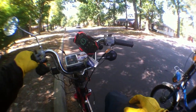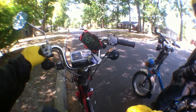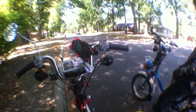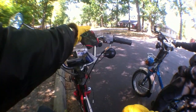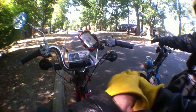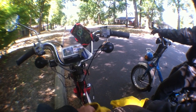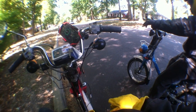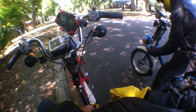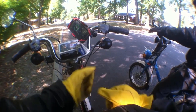Here's Carl and I having a little powwow at the pass. His bike was running kind of hot today and we kind of corrected that. We might have to do some more, but his does right around 40, 41, 42 miles an hour. His compression is pretty low, so his acceleration suffers as a result. I told Carl he probably doesn't want to ride with me anymore now that we have the new improved red QT50 with Jimco exhaust and HPI ignition.